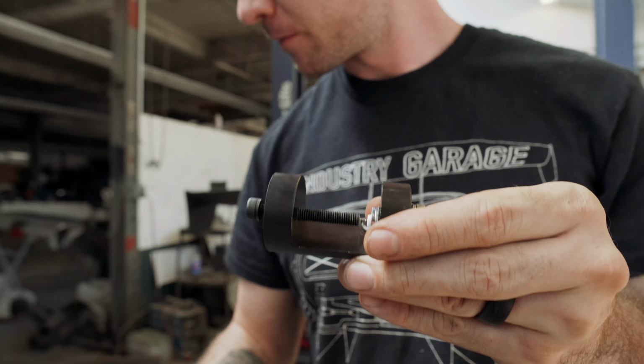So that's just about where we want it. They weren't crazy. They weren't like tons off. They were probably in the top of that range, I would say, maybe. You want to make sure you're measuring it with the bolt off of the head, obviously. Because it can still have some pressure on it and it'll give you a false reading. Yeah, so that 19's tight right now.